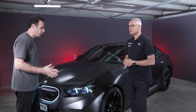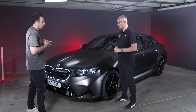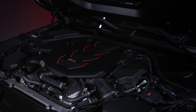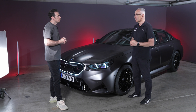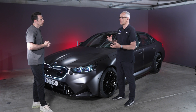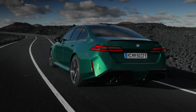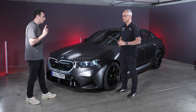How is this drivetrain different from the one in the BMW XM? There are both hardware and software changes. The V8 engine and gearbox with the e-machine are nearly the same, but the cooling system and exhaust system are completely different due to the different package and layout. The setup is tuned to be seamless — we don't want the driver to feel when the electric is working and when the combustion engine takes over. Where the combustion engine needs a little support, we use the electric motor to add momentum to the powertrain.